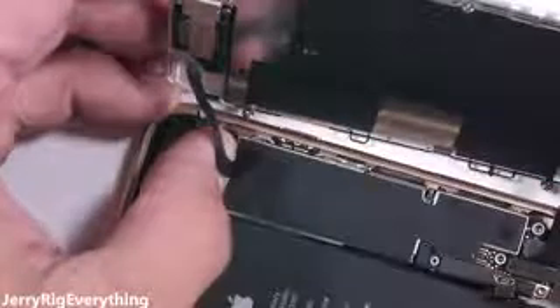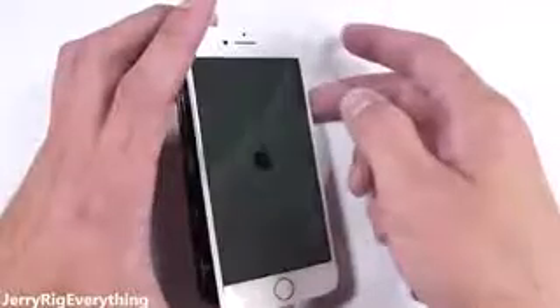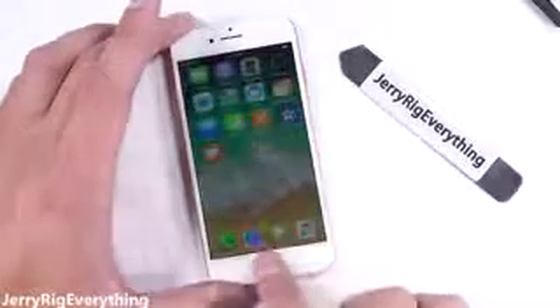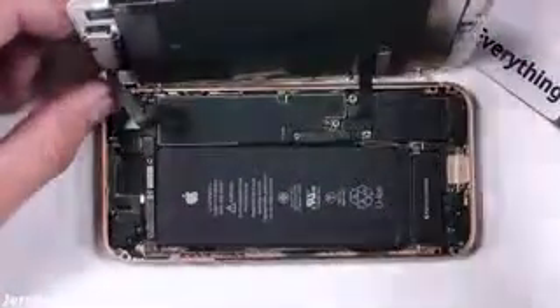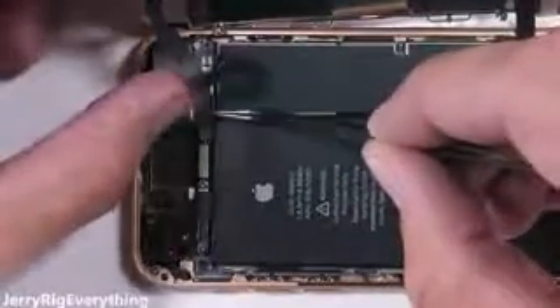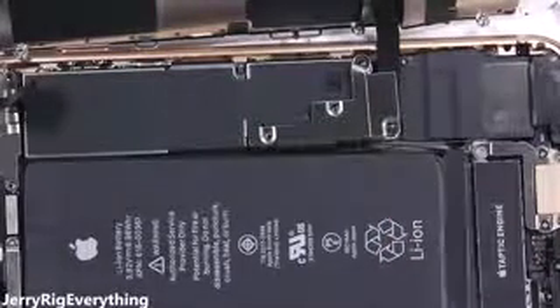Now that the screen is assembled, it's easiest to plug in the top ribbon into the motherboard first since it's at a weird angle, then the bottom LCD and home button ribbons clip in after that, just like little Legos. The battery is the last thing you want to plug in. I usually test the phone at this point to make sure the new screen functions. If there are lines going through your screen or it doesn't turn on or look right, it might be a bad connection with the motherboard or just a bad replacement screen — double check the connection first. The metal brackets that cover the connections keep everything down tight just in case you drop your phone. Three screws on the top metal bracket and four screws on the bottom metal bracket — all different sizes, so make sure the screws get back in the right hole.